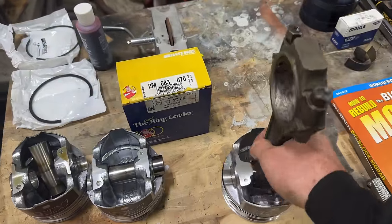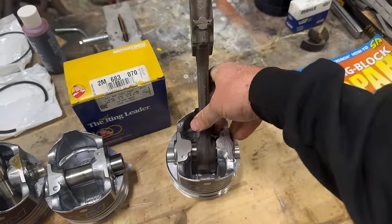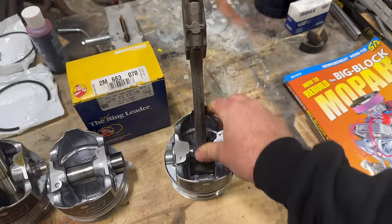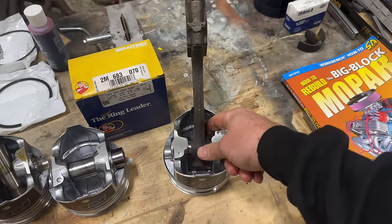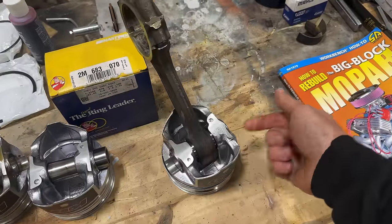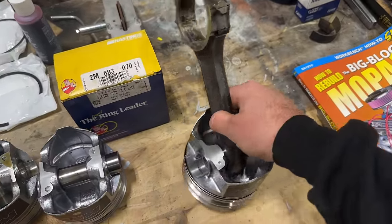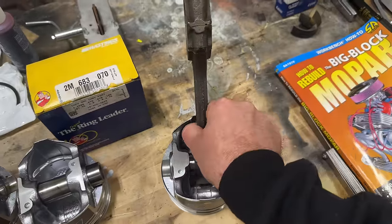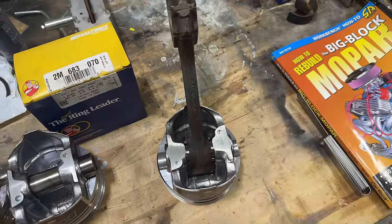But yeah, so you pound them out, and I watched a few videos on how to put them in. Basically, the video said to just take a torch and heat the end of the rod until it's a dull red, and then take your pins and push them through. Well, the first one I did gave me a ton of confidence. It slid right through, centered up, fantastic. And I was pretty excited about it, not gonna lie.